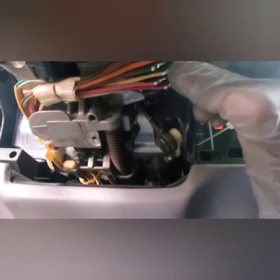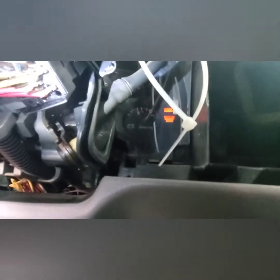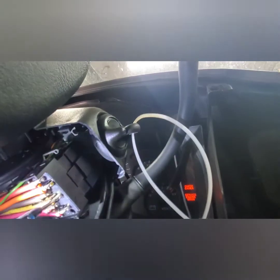Or I'm thinking there's two problems, because when I turn the keys, power is supposed to come on this yellow wire on the pin, and I'm not getting any power there too. So there are multiple problems here. First I'm gonna check this wiring and see if it's broken anywhere, and then I'll have to figure out why when I turn the switch I'm not getting power at this pin right here. So I'm gonna check that out. I'll be back.